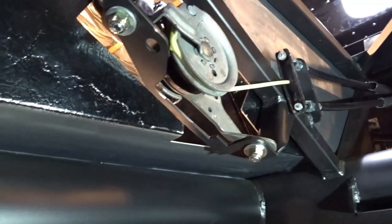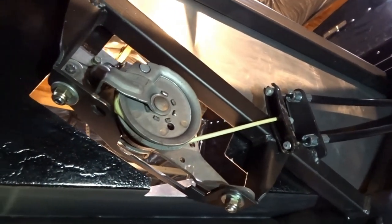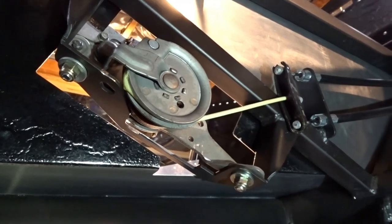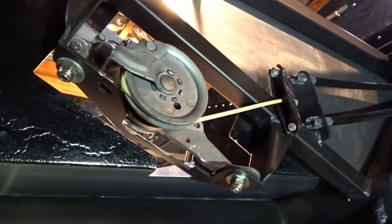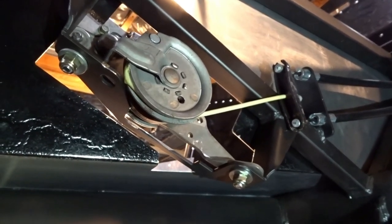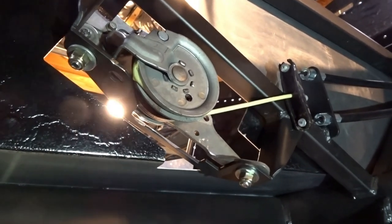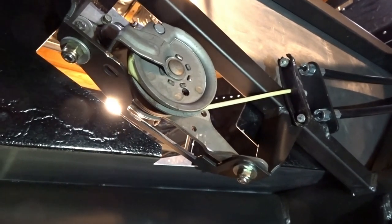We used that, and what I did is I adjusted it before I put it in. If you're looking to see how to adjust one of these donor handles, go online, go to YouTube, and just type in Fox Mustang or SN95 Mustang brake handle. There's probably two dozen different videos that show how to modify these to make them work a little bit better. The later ones, like this one from the 2004, already have the modifications done to it.